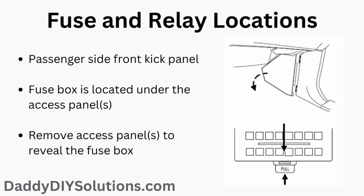No worries. We did a bit of extra research to determine the exact location of the fuel pump fuse and relay. In order to locate the fuse box, locate the passenger side front kick panel. The fuse box is located under the access panel. Remove the access panel to reveal the fuse box.